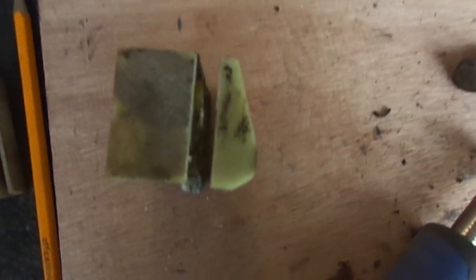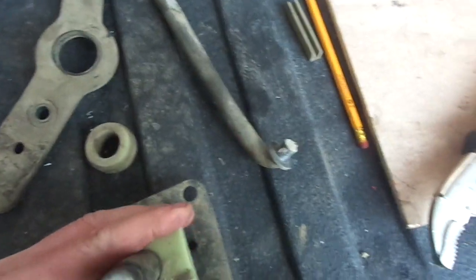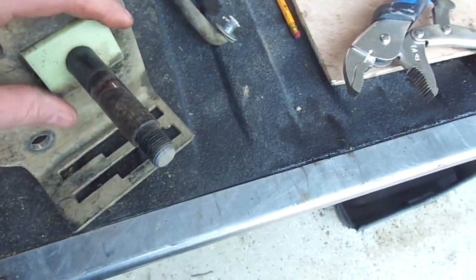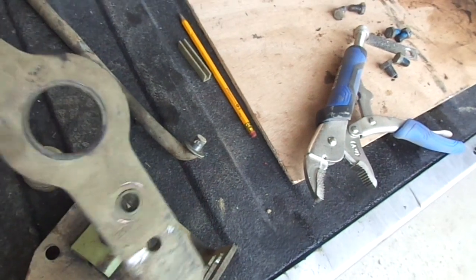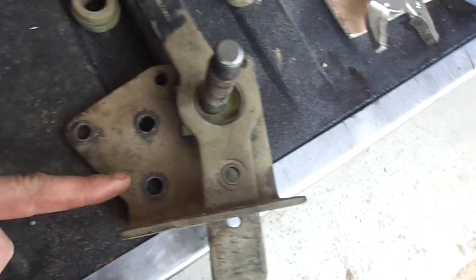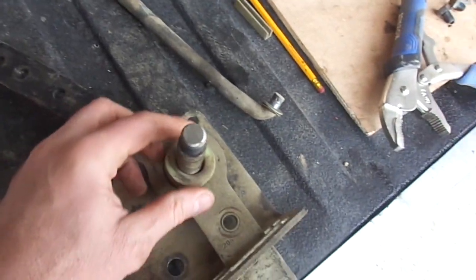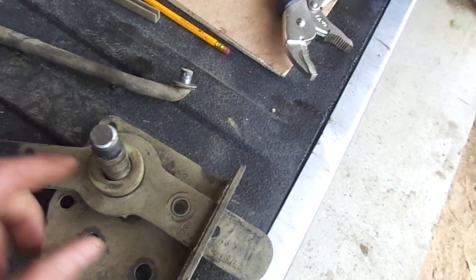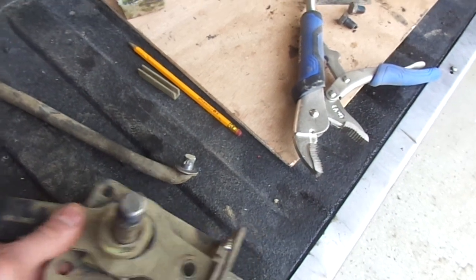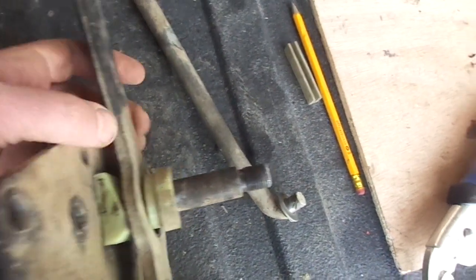I should have shown this plastic block before I bandsawed it, but it was one piece and I bandsawed this section off. This plastic block goes on here. It's a little difficult working one-handed. So it goes on there like that. Essentially, with spring pressure, it goes on here. Your rod, your transfer case goes here, and then this bushing goes in here. There's a spring and then a nut, and that puts spring pressure on this transfer case shifter, which forces — being this kind of wedge shaped — it forces the handle sideways.